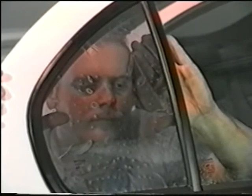After the film is in place and carefully positioned, spray the film and begin to squeegee out the water from top to bottom. When squeegeeing is complete, wrap your hard card in a cloth and use the dry blotting technique to finish the window. The dry blotting technique will eliminate moisture at the edges of the film to prevent fingers from forming.